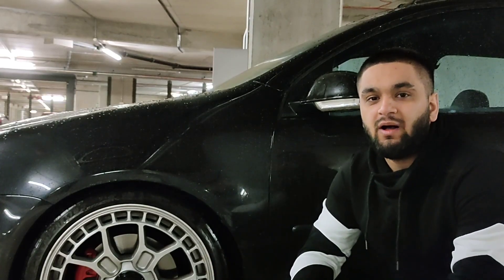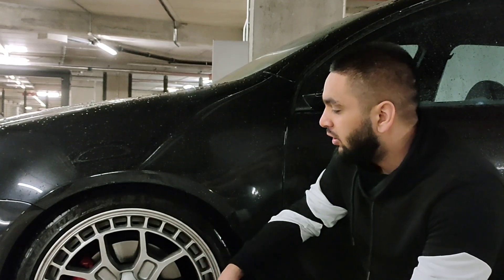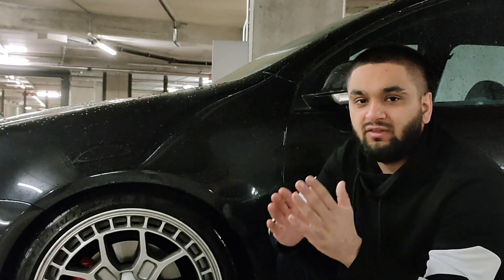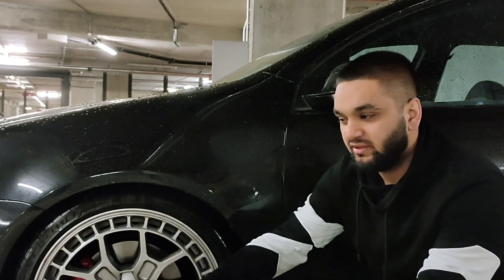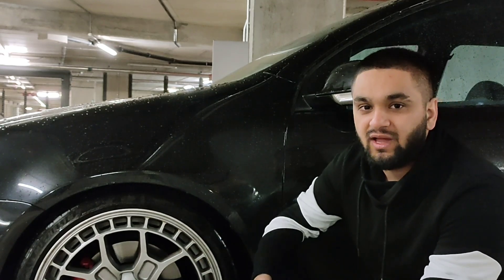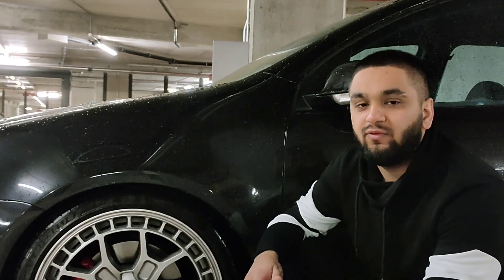Issue number four: I have this horrible screeching noise coming from this wheel. I've seen this all before — basically what it means is there's probably a stone or a little bit of dirt stuffed between the brake pad and the brake disc. At low speed you can hear the stone rubbing against the disc, causing this horrible screeching noise. The only way to solve this is by removing all the brakes, cleaning them down, spraying them with some brake cleaner, maybe a little bit of sandpaper, and then throwing it all back together.